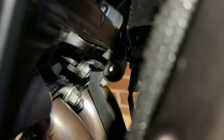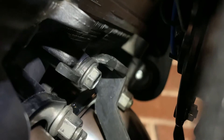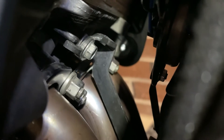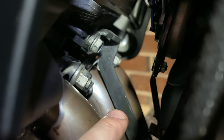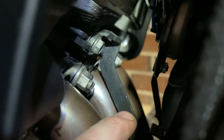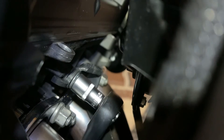The next stage is that 10mm bolt right there holding the bracket to the radiator. It's essential to remove this first, as the close proximity to the headers means it won't allow the headers to come off unless this bolt or bracket is out of the way. Just use the 10mm socket to undo this. With that bracket removed, we move on.